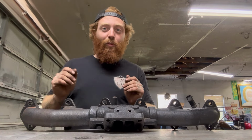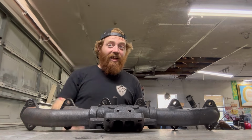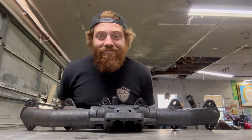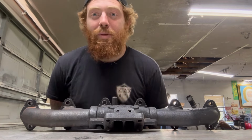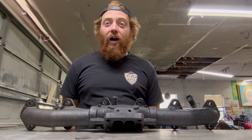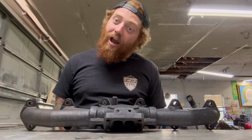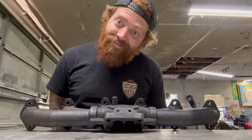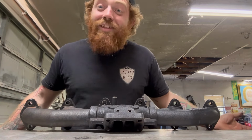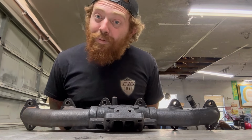Side note, it drives me nuts. Everybody does these little blow-by tests on their 12 valves, right? They take the oil fill cap off, and they set it on there, and it doesn't dance around. Block your PCV, bitch. Do it. Let's see that cap fall off. Where's your blow-by going, buddy? Is it all going out of that hole? Do you have a PCV? You do. Block it. Tell me how it goes for you. I know how it goes for my truck. That cap's in fucking Narnia.